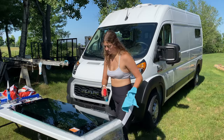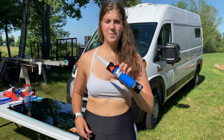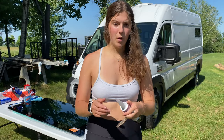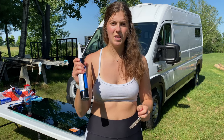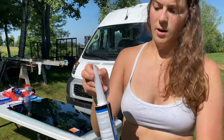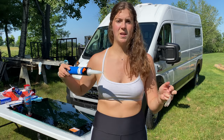Spray down the window and clean both sides before applying just to make sure it's nice and clean. After the primer is dried, you're going to put on the Sikaflex that comes with the window — you can also purchase it through the same company. You'll need a caulking gun with a 26 to 1 ratio because this stuff is really thick and hard to push out of the container. There is a V cut on the top of the nozzle that you need to cut along so that when you're applying the bead to the window it has that nice shape all the way through.